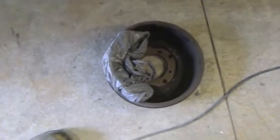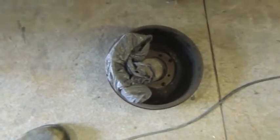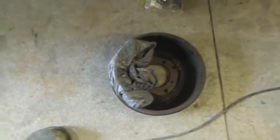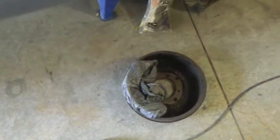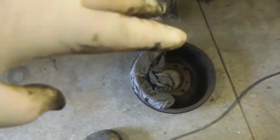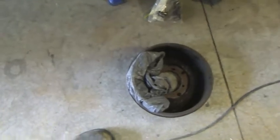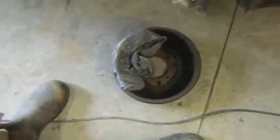Always with brake pads, or brake linings I should say, these ones are going to get replaced and rebonded. I'm treating them as asbestos, I think they are, I'm not sure. So all of those are going to go up, wrap them in plastic, and they're a bit safer that way. Don't forget to use water when you're dealing with these things, keep them wet at all times. And the new ones you get will be much safer, because it's illegal to actually use asbestos now in brake linings.